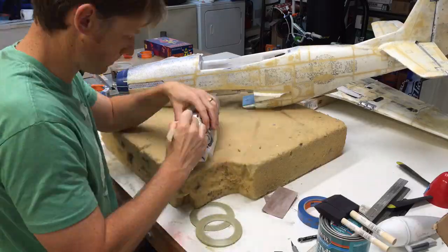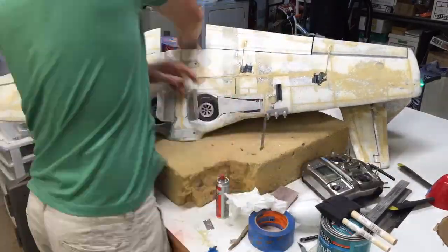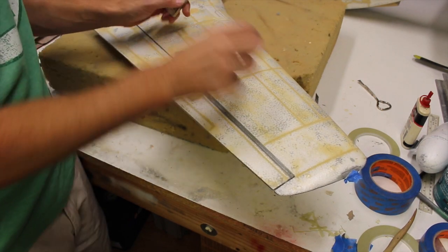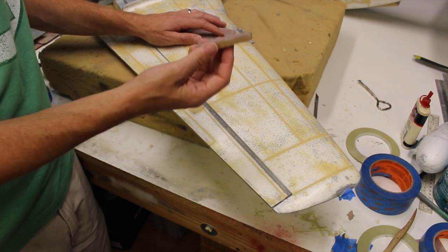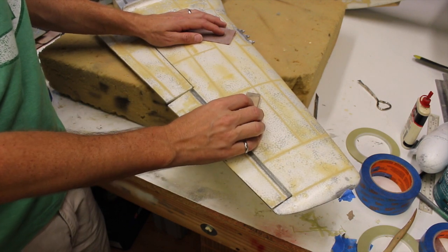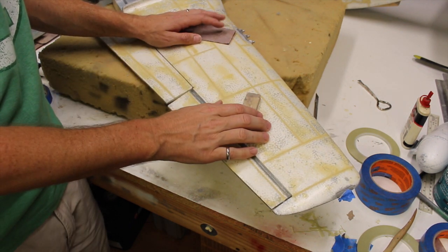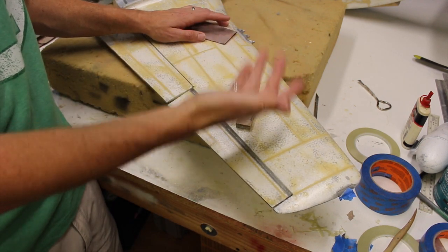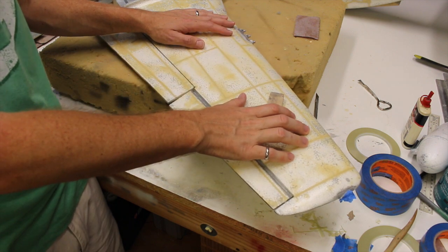While we're doing this, we'll protect our landing gear as well — extend the landing gear and put some paper towels in there so we don't get any paint on the wheels or struts. With everything masked off — the canopy and the wingtip lights — I'm going to use a small sanding block to block sand the whole thing as best I can. That'll even it all out before we primer. Then we'll do a couple of iterations: prime it, sand it, prime it again, and it'll be ready to paint.